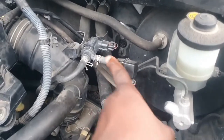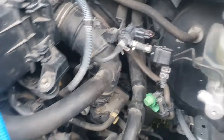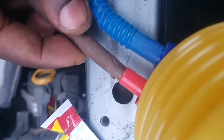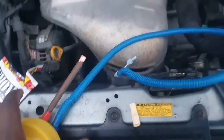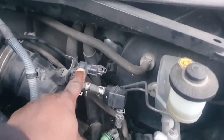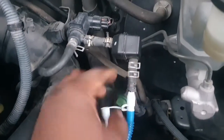We're going to first check the purge valve up here to see if there's a leak in this system. If there is, we'll see smoke coming out from one of these hoses. To light up the tool, pull off the tip like this and give it a gentle twist — that's what you insert right into the pump. Now that I've lit the cigar, I'm pumping it and I've got a good amount of smoke. I'm going to insert it into the portion that goes to the purge valve and see if there's any leak.